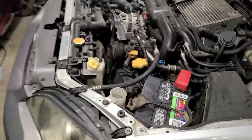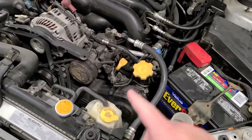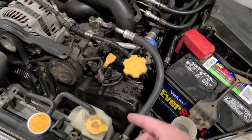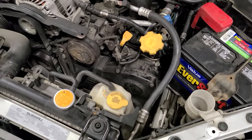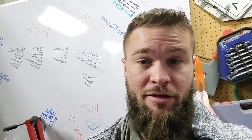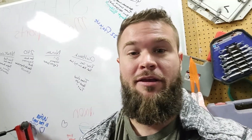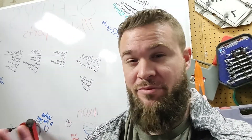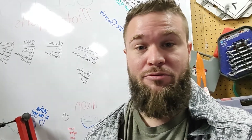So we're going to play a game today. I'm going to call it Cracked or Fact. We are going to pull these covers off on both sides and then take the exhaust cam and pull it back one tooth. I have read people are doing up to two teeth — we'll start with one and go from there, and then we'll test it and see. I've started a map, so this car does run better, but it is still lacking something on the bottom end, so hopefully this wakes it up on the bottom end.